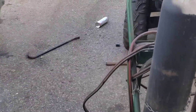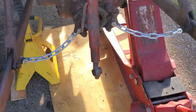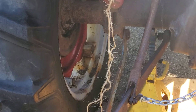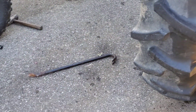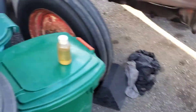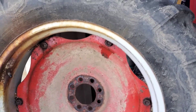One thing that almost got us into trouble — when you jack it up, I jacked it up off the center, and the weight of those tires — my god, it pulled it right down. So remember: you've got to do jack stand and jack, because the tire is such a heavy tire. That's the way it's got to be, so don't forget that. Anyway, we'll get back to it — we're on the home stretch.